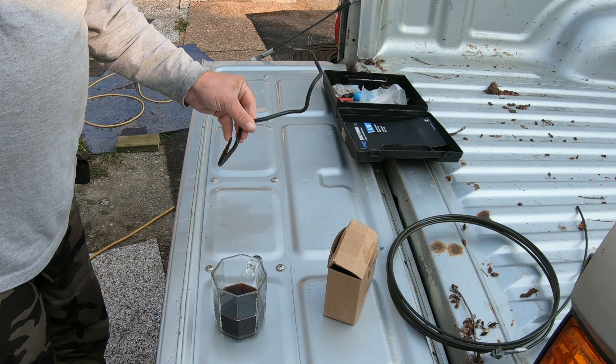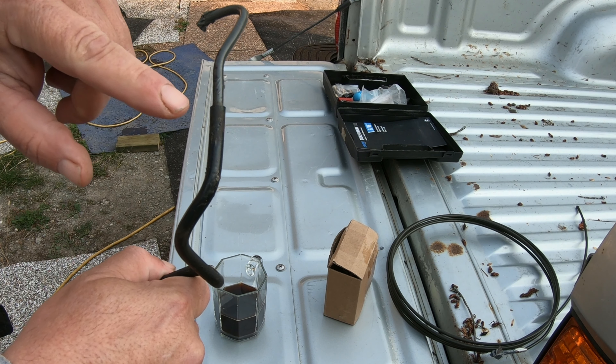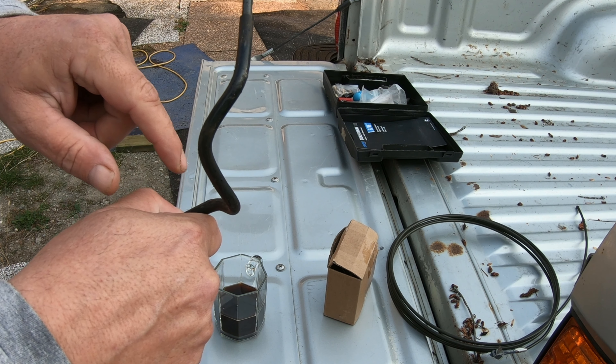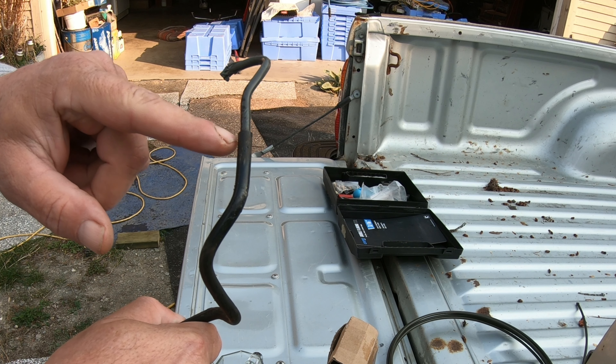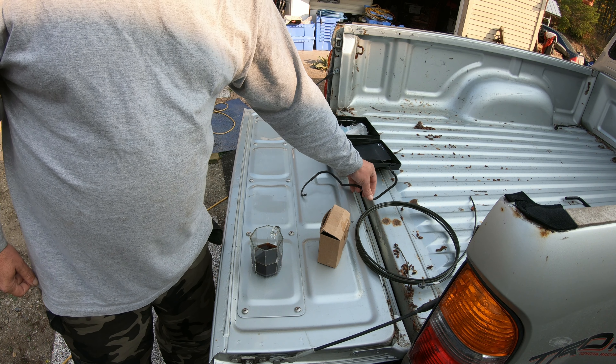So the reason I'm changing the brake lines — Toyota was smart when they put these brake lines in. So this is one of the bad lines. What they did is they put rubber all around the brake line and it protects it. They still look like brand new underneath, except for the ends. They stopped the rubber right here and all the ends are just unprotected. Here's an example of that right here — completely rusted out. It's like that with all the lines under the truck — all brand new except for the ends. That's why I'm replacing three lines today.